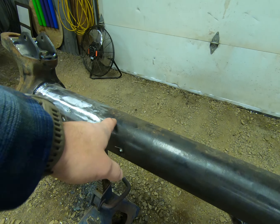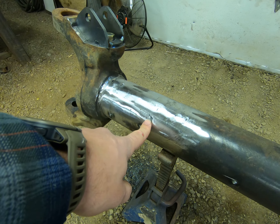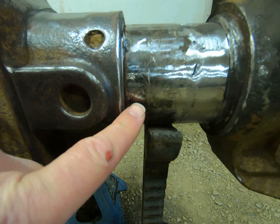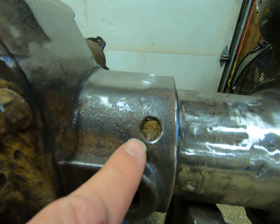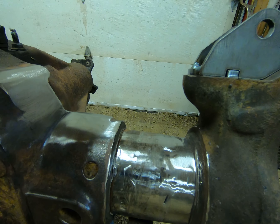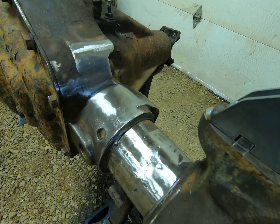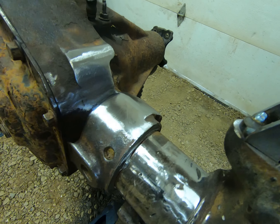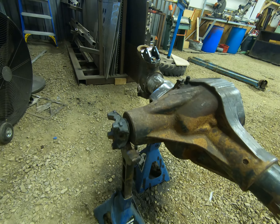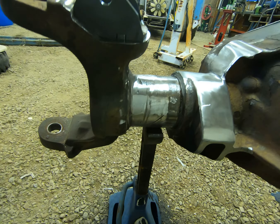Things left to do still: this paint and a little bit of rust — I want to grind that off, I'm just going to hit it with a flap wheel. I still got to fill in a couple of spots where I kissed the axle with the torch. I got a couple of these factory plug welds that didn't penetrate the axle at all, so I had to cut off about two inches on this side so I could get the truss to sit flat. I'm going to put a small groove in the side here all the way around, and then do a circumference weld here and a circumference weld here. The Sawzall did a really great job cutting this out — I did a quick blend with the flap disc and I am happy.